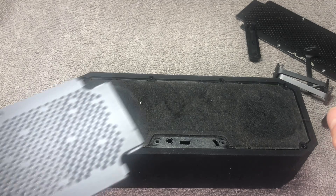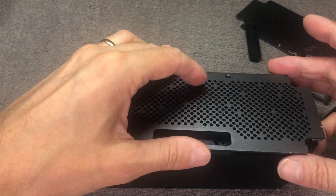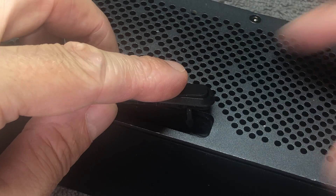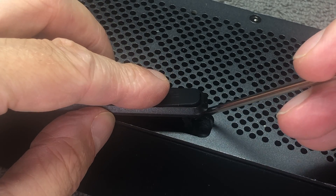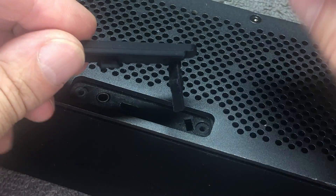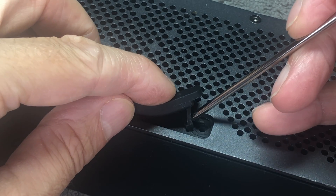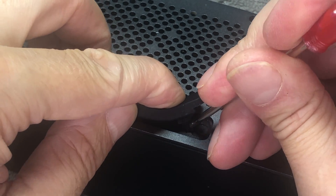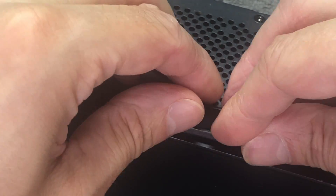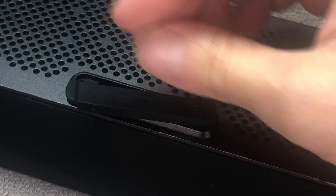Continue installing the back plate — make sure it's in the right orientation by looking at the little noses on the corners. Place it in and put the six screws back in. Then reinstall the dust cover: put the rubber in and squeeze it into the hole with a screwdriver — it's a little finicky. Once it's in, put the small plastic bracket around it and don't forget the two small black Phillips screws on the sides. All other Phillips screws are silver.